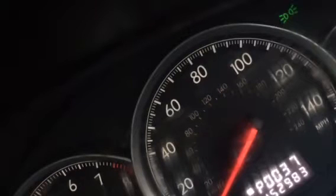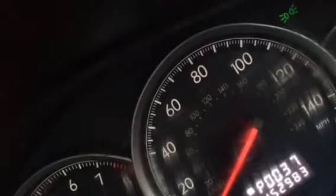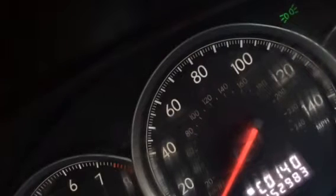So there's your P code — that's your engine fault code. You can now cycle between your fault codes. P0037 is a code saying my second oxygen sensor is faulty. That's the only P code I've got. And that's a C code — my body control module telling me that my air con gas compressor pressure is low.